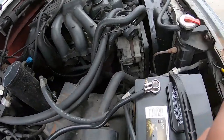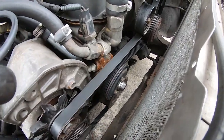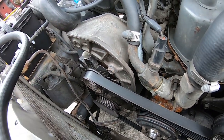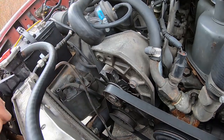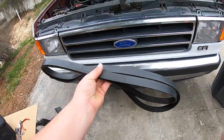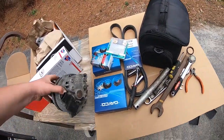I've got to be careful going through this to make sure my wires aren't crossed. First thing I'm gonna do is disconnect the battery. I got my fan and shroud off - that's going to give me a lot more room in here. I noticed this alternator is mounted where the mounting tabs are not 180 degrees from each other, but the alternator I bought has the two ears 180 degrees from each other - straight across. It looks like this bracket accommodates that, so hopefully I don't have to buy another alternator. I got the belt off - I think it was probably fine but I'm gonna put a new one on anyway since I'm already in here.